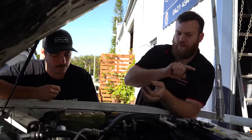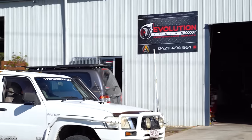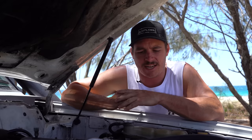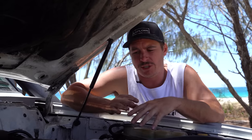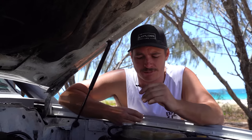We ended up with the twin turbo, front mount intercooler, and bigger injectors. We went from 200 horsepower up to about 289 horsepower and 710 Newton metres — absolutely insane out of a little four-cylinder ZD. Keep in mind those figures were on the smaller tyres — tuning was done on 33s before we rebuilt the car, so I've probably lost between 15 and 20 horsepower running the 35s. But this thing has got all the torque coming on really low down. Go watch the build video for the dyno charts. The drivability is perfect, especially for wheeling — the boost comes on really early, the torque curve starts nice and low, and this thing drives like an absolute beast.